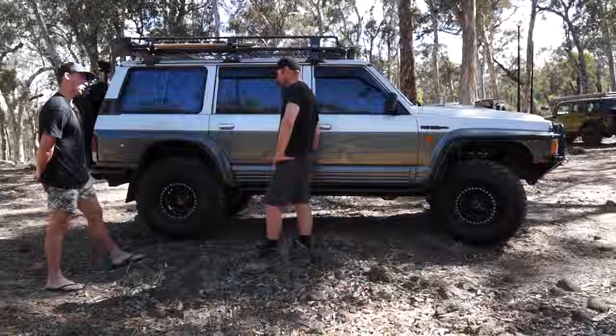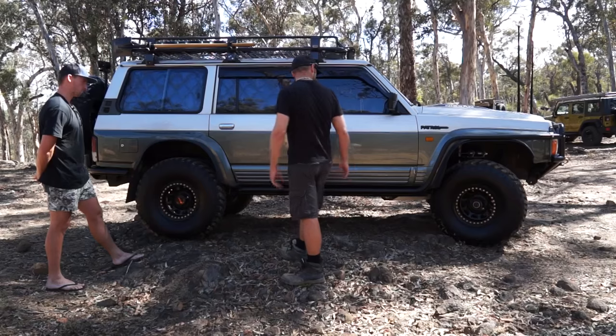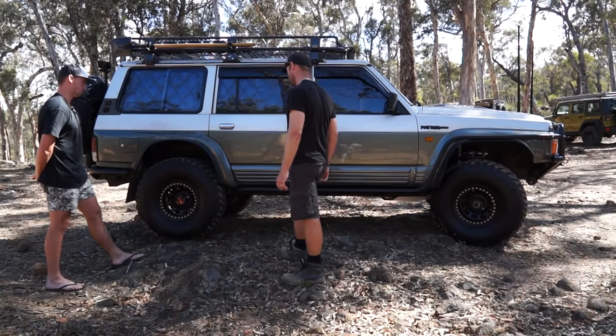So especially on the beach, you can really air your tyres down to low, low pressures. It's hard to get a unique looking steel rim, and they actually look pretty unique. Specific offset on these? Yeah, they're a negative 30. Negative 30, brings your stance out? Yep, so they bring it out a fair bit, but it still fits inside the guards.